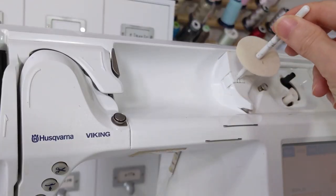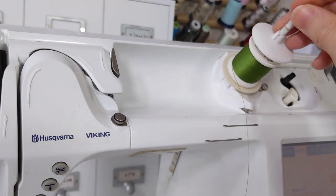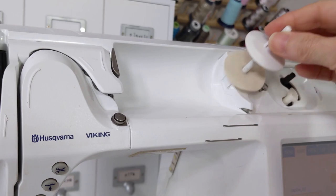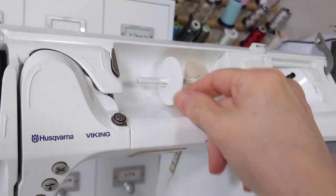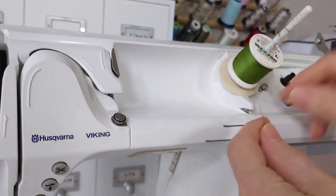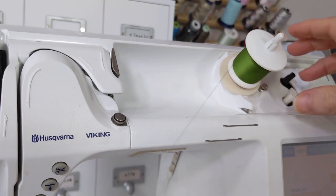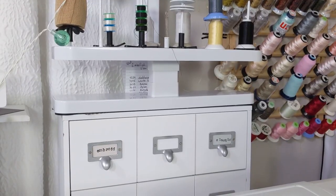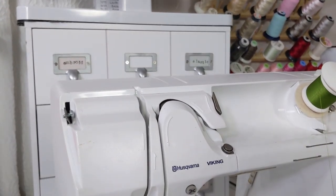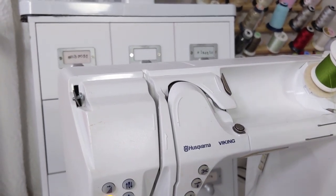For the upper thread, it starts at the spool. Your spool goes on the spool pin, and there may be a spool cap that goes on top to keep the spool in place. Spool pins can usually go vertical so the thread is standing up, or horizontal so the thread is lying sideways. The felt pad isn't really needed when your spool is sideways, but when your thread is vertical you definitely need that felt pad under there to make sure the spool can glide easily. The cap keeps the thread from bouncing around — not too tight so the thread can still move, but not so loose the thread pops off. If you're using a separate thread stand, you still have to thread everything all the way through the machine — pretend the thread stand is just your spool and then everything else still has to come afterwards.